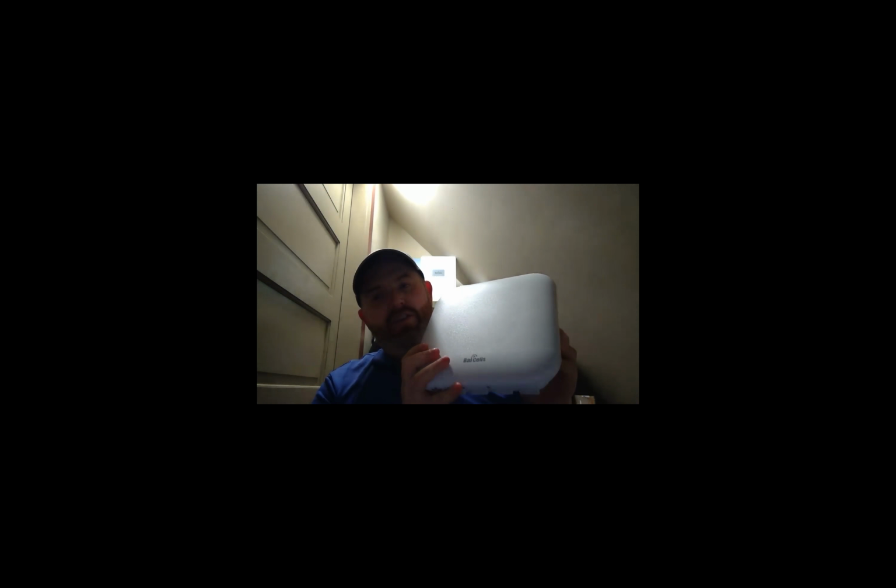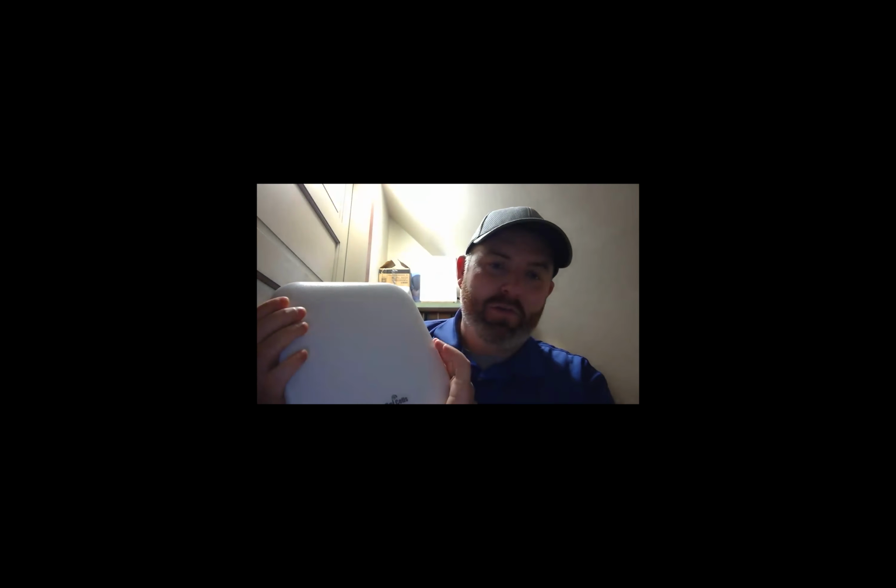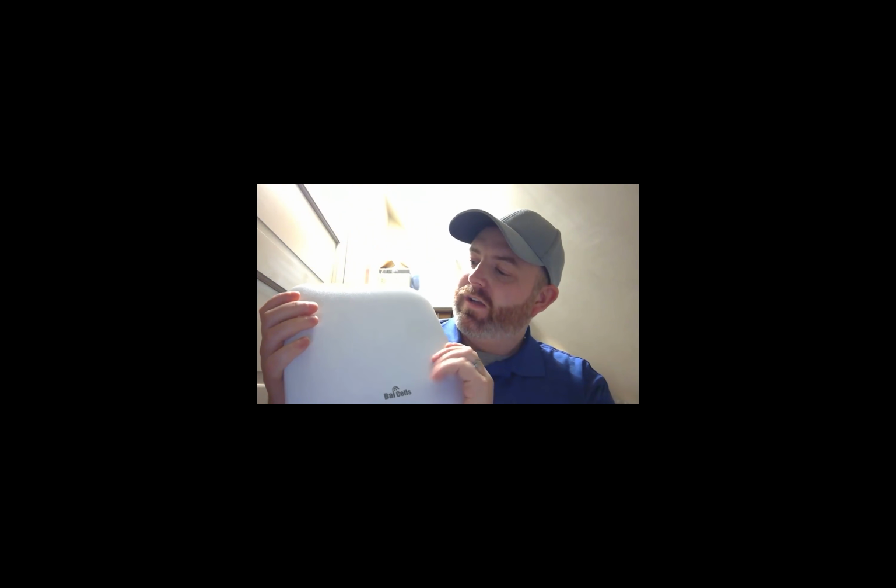Otherwise, like I said, I'm going to pop it up here one more time. I actually love it. I actually have this particular unit. Oh, thank you, Katie. $9.99 to the end of the year. This one has been in testing in my laundry room, shooting out my wall. I've been testing with a 19.5 CPE about a half a mile out, connecting at -98 RSRP, and I was pulling about 75 meg down and 6 megs up. That was about the peak I was getting, and that was through a heck of a lot of trees up here in Maine. So good coverage. I mean, don't expect it to work miracles. It's not going to go 10 miles through a set of pine trees.